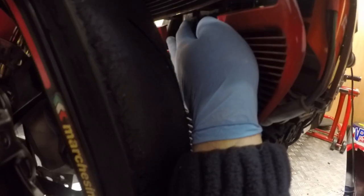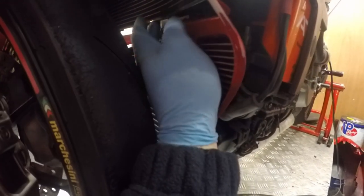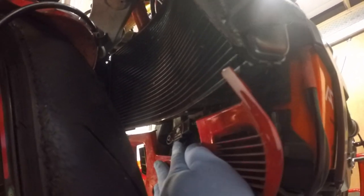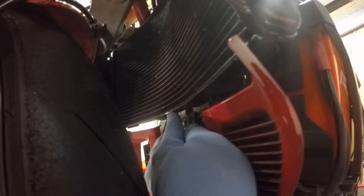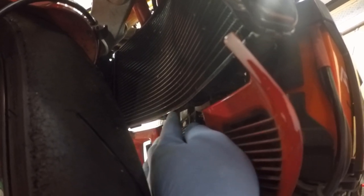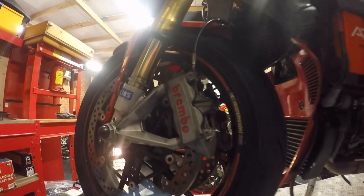The key piece was to make sure I re-secured the radiator, because as you'll remember from the last video, the bottom of the radiator fouls getting that HT coil out. You have to take off the bolt that sits in there and the bolt sits up there, and that gives you about 10 millimeters of movement up to just clear the little fins on the side of the HT coil that catch on the front of the radiator lip. Moving that up by about 10mm gives you the clearance to take that off without having to fully remove your radiator.